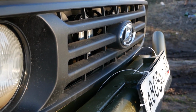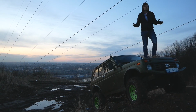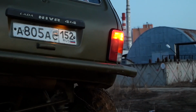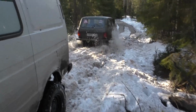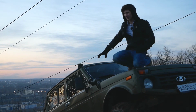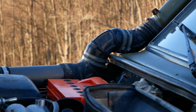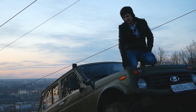Headlights are halogen, they are constantly flooded with water. The main problem is they're not bright enough, but they are waiting for a retrofit to Land Cruiser 200 LED beams. Rear lights in trails were replaced with Mitsubishi Outlander's LEDs. Snorkel was made from swimming pool pipes. Some made it from sewer pipes, but they're not durable enough. Previously, an extra high beam on the roof, as we call it, chandelier, and brush cutters were installed here.